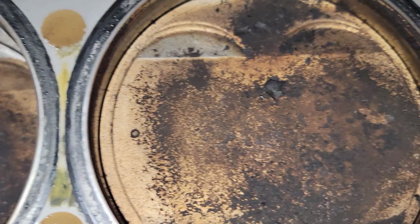Got the fuel rail out right now. This one injector decided to pop off the rail. There we go. Now that one's out. Man, that ring shot. No wonder it was stuck in there. Get this unbolted. And everything comes apart pretty easily on this. I'm gonna get the coil packs off both sides, and then we're gonna get the spark plugs out and see what they look like.